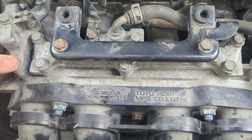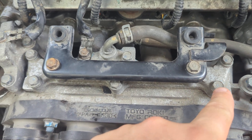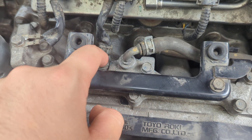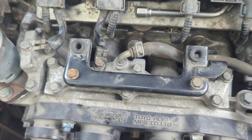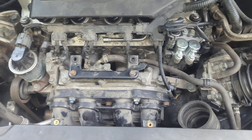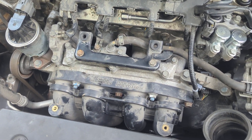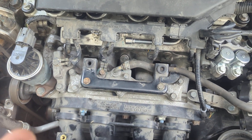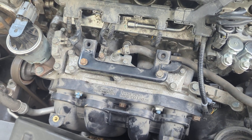This will come off and there will be a metal plate that runs the length of this and is the same shape. You'll want to unclip this part — this is a ground wire, just set that back. This will come right off. You can clean the carbon up inside of there with a screwdriver, pokey tools, and you'll need a shop vac.